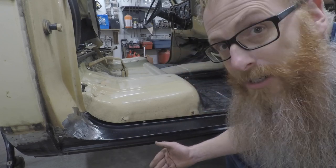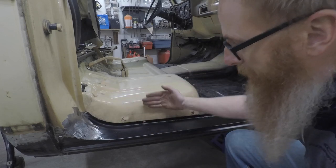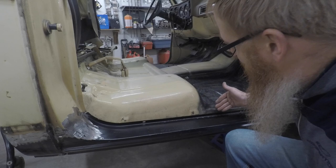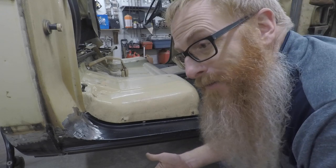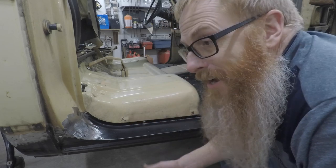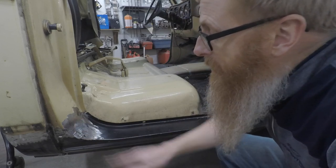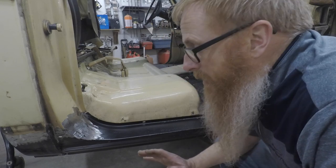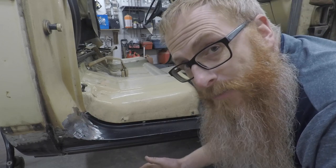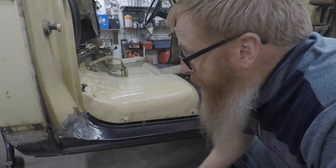The seam sealing is mostly just this seam down here where the rocker panel meets the floor. By doing that we're going to help keep any dirt and moisture from going down through there, and also keep dirt and moisture from coming up from outside. We're going to do that tonight, and then come back in another video to do some body fill on these seams, get them sanded down, primed, and then get a coat of color matched paint on this truck. Let's get out the seam sealer and get these seams sealed up, then come back tomorrow and start some body work.